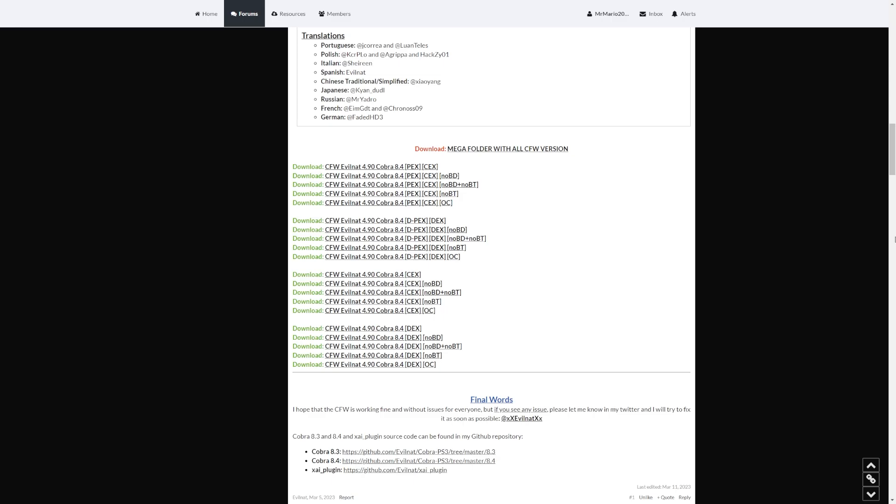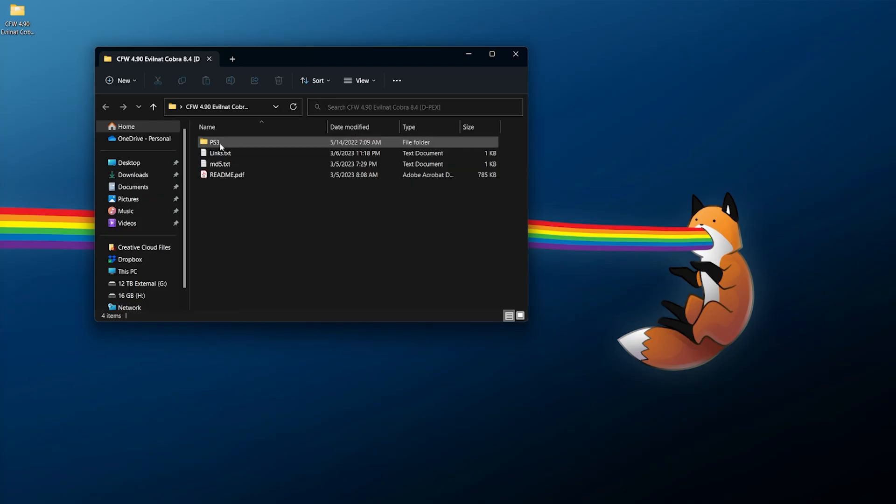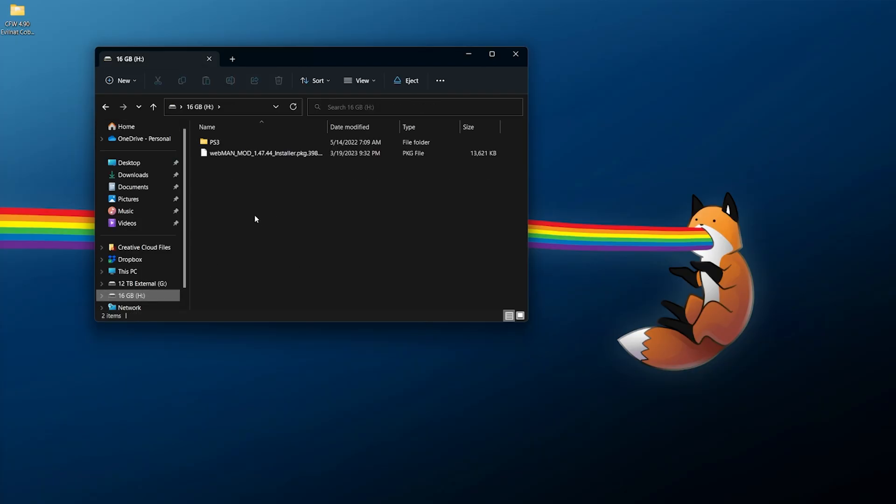Scroll down — if a new firmware update comes out, you're going to want to download the latest DPEX available. Because your console is in DEX mode, don't download the version that just says 'DEX' — that is for consoles that are actually real development systems. Since you have a retail system that's been converted, you want the DPEX update. Just like any other update, download and extract DPEX, copy the PS3UPDATE file into the proper folder structure on your USB drive — it's the same process we already covered.